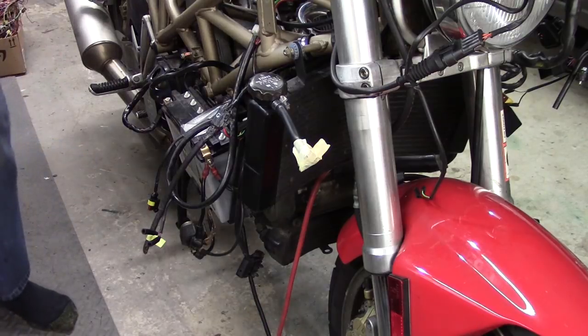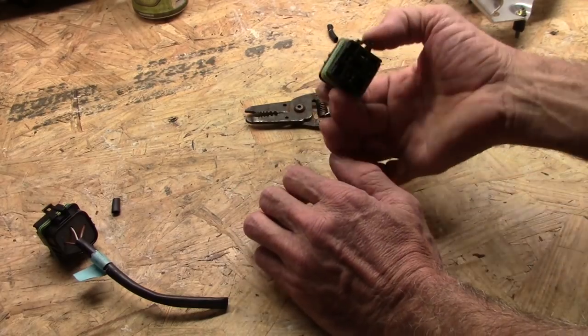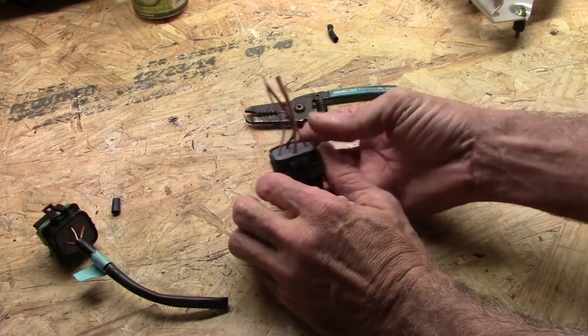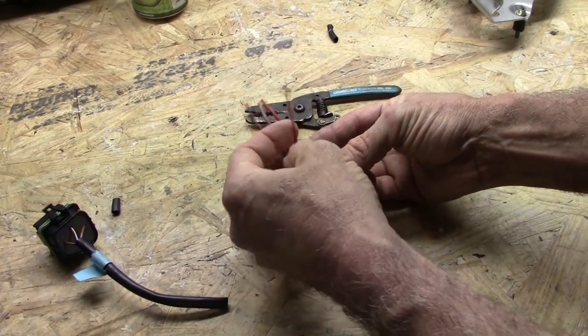I'm missing a ground wire somewhere. So temporarily I just used a chunk of ground wire on the negative to the frame right there — let's try it again. Good enough. Well, that's good for it; probably hasn't been turned over in quite a while. So next up are the connectors that go at the rear of the harness under the seat — I need to splice these in where they were cut off before.